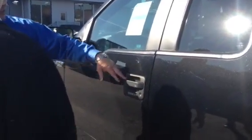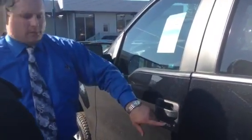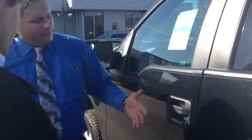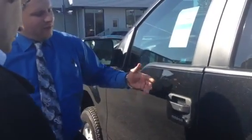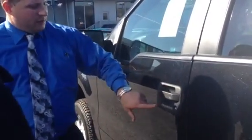You ever go to the beach, go camping, anything like that? Okay. So the idea with the keyless entry is that you can leave your keys inside. Every vehicle has a personalized code that comes with it, and you can customize that code, but the factory code will always work too. The benefit is you don't have to worry about losing your keys, or if you're on a job site, you can leave your keys in there, come in, enter the code, and that's it, okay?